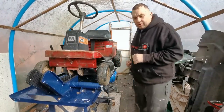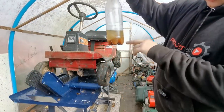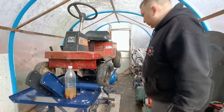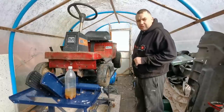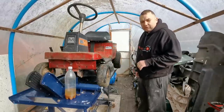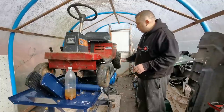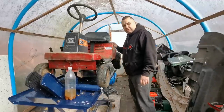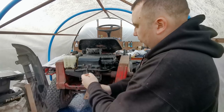I'm going to give it a bit of a clean down. I've got some old fuel here - this was out of the Thundercat tank if you remember. I'll pour the top bit of petrol out into a cup - it still smells so it's still clean, it's just full of crap at the bottom. I'm going to get this cleaned down, blow it down with the airline, and then I'll come back when we're going to start stripping this engine down - take the carb off, clean that tank out, have a look at the air filter, give it a bit of a service, and then maybe look at the belt underneath.